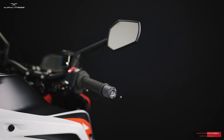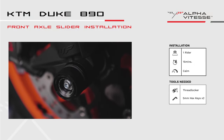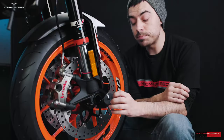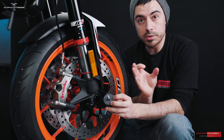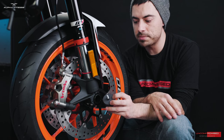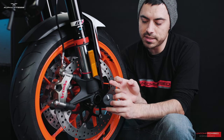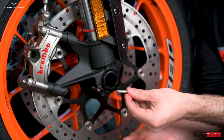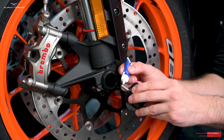Let's get to the installation. The next item on our list is the front axle sliders. This is a fairly simple installation — you just have to be sure to grab the correct adapter, left and right, as they are different. If you have any doubts about which one goes left or right, the installation manual comes in every kit. If you've misplaced it, you can download it from our website. In this case, we're pre-assembling the left side. I've grabbed my left adapter with a puck, and my 45mm bolt with washer. Pre-assemble that and place one drop of threadlocker at the end.